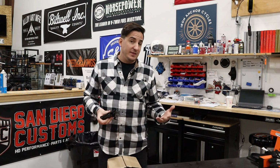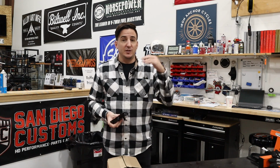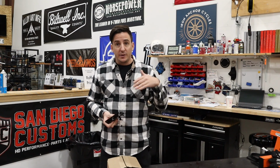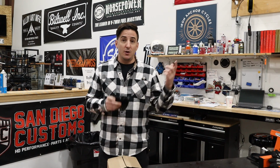Now, that's not a bad thing necessarily, but if you've got oil that's coming up through there as a result of there being a lot of pressure and the oil getting caught up in that air moving up, you're gonna get oil going into your air cleaner, and you're gonna get really two problems that are gonna happen there. Oil's gotta go one of two places.